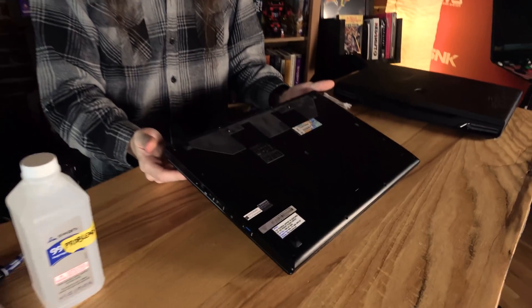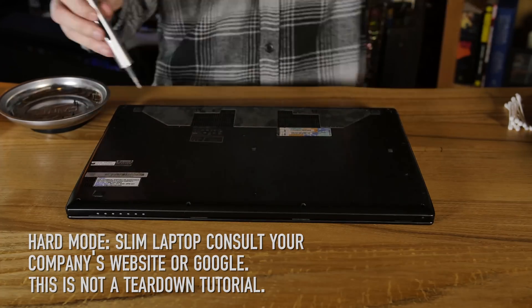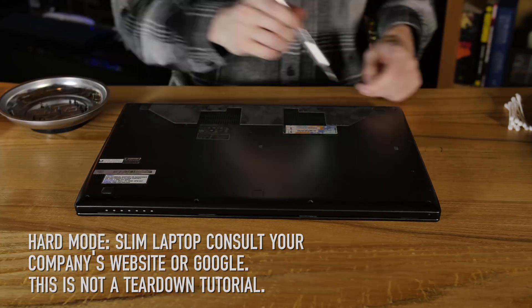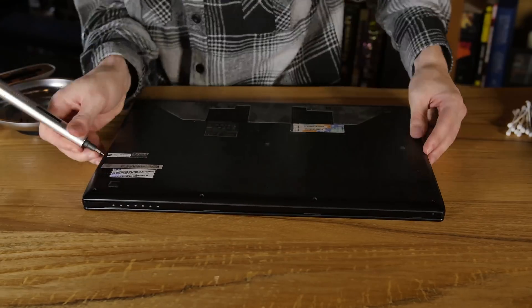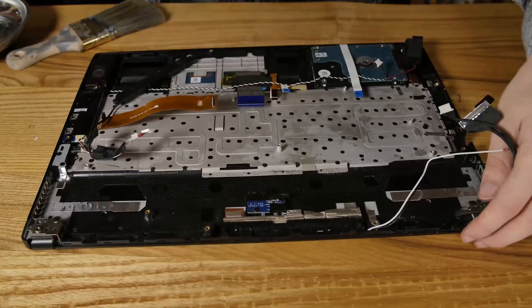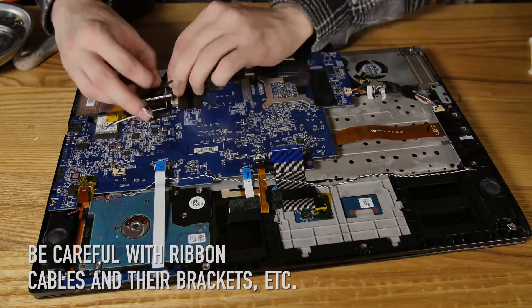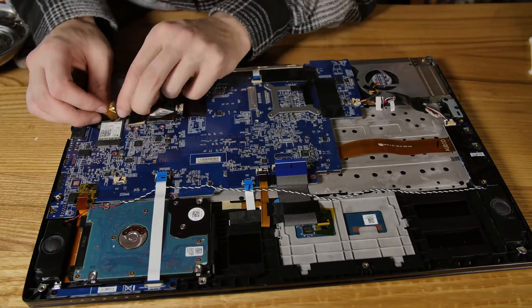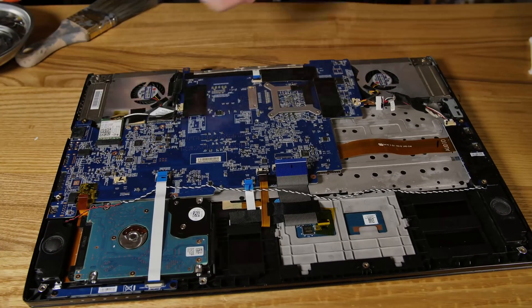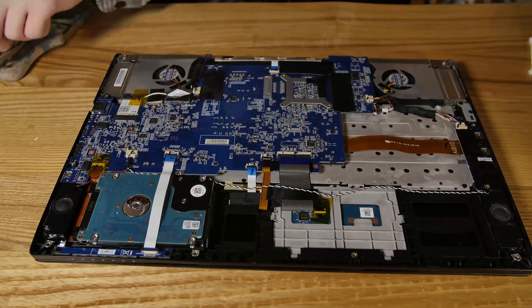We're going to start with the MSI. It's not going to be indicative of your laptop — you'll want to look that up online to find out how to take it apart. But we're just going to do the MSI and the Alienware today, and you can follow along with your own machine. Just look out for a couple of things: ribbon cables and screws. For screws, magnetic trays are awesome — get one, we have the link in the description. Ribbon cables: keep an eye out when pulling the system apart. The little levers on top are really easy to snap and they're not replaceable, so be very careful with those and make sure every single one gets put back exactly where it was.